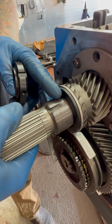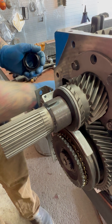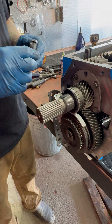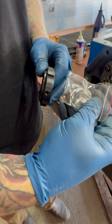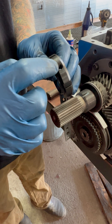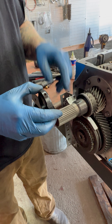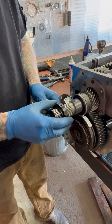There's one staking surface right there and one staking surface right there. You just use a punch like this and get a really good stake down into that pocket. These little set screws with the brass — what I'll do is set the brass piece into the pocket, use a punch, and basically you're adapting it to the threads, smashing it down in there, and then using some Loctite on those as well.